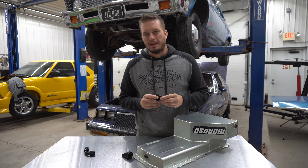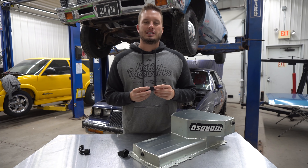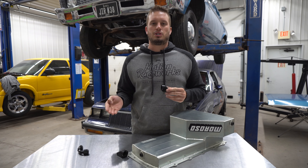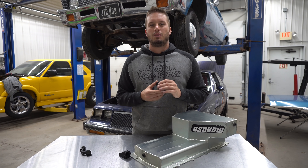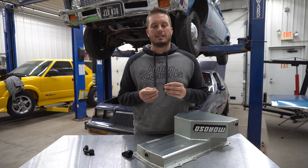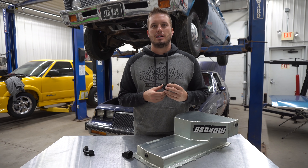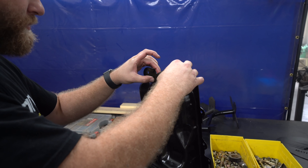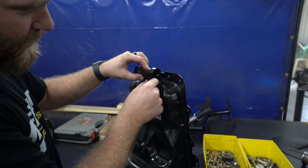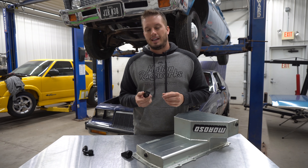But that's not what we're talking about today. One really cool use we recently discovered — if you look back on the El Toro project, I didn't have a steel number 10 AN weld bung and we last minute kind of forgot all about putting an oil drain in. So we took one of these and put it right on a stamped steel valve cover and it worked phenomenally.